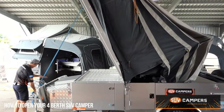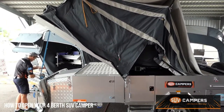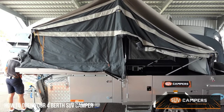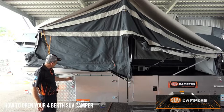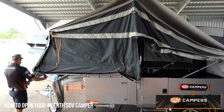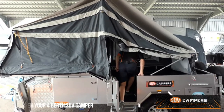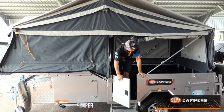Wind it all the way down and as you get to the end, engage the ratchet — that'll hold the lid down. Come around to the side of the camper; depending on the model, there are latches on the side that lock it in place so it doesn't flip back up. Go to the corner of the camper — the canvas has these nice little pieces that wrap around and lock that whole corner in really nice and neat. Then open the main entry door, come inside, put the back bow up, it automatically locks into place. That's as easy as it is — easy camper trailer.